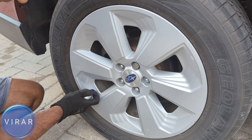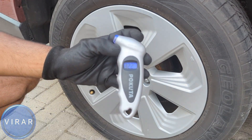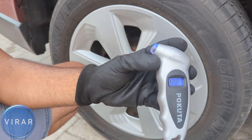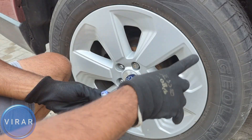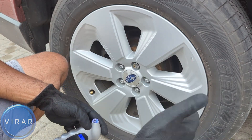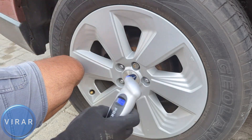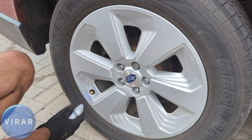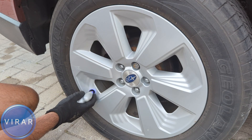Lined up — push it in. The reading is 32.2 psi. This is for the front tire, which was sitting out in the sun facing the sun all day long — that's why the pressure is a little bit more, and that's okay. But if you hold the tire pressure gauge at an angle, you end up actually leaking air out of it. You hear the hissing sound? That's what it is.